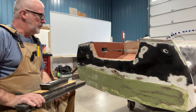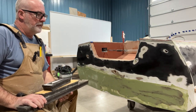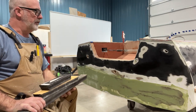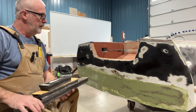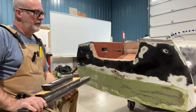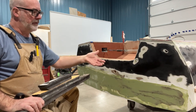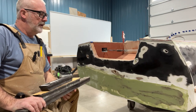As you can see, my Total Fair fairing compound has hardened and will be easy to sand now. If I had wanted to put on another coat, there's a point at which this fairing compound — you can put your fingernail into it a little bit and it's still considered what they call green, or ready for what they call a hot coat, meaning a second coat. Much like fiberglass epoxy: if there's a little bit of greenness in the resin, you can still put on another coat without having to abrade it or clean it with acetone or soap and water. You can just go ahead and put another coat on.